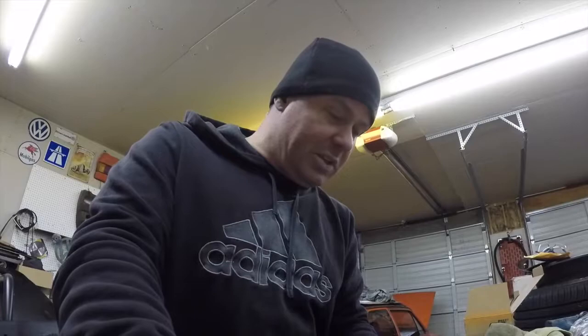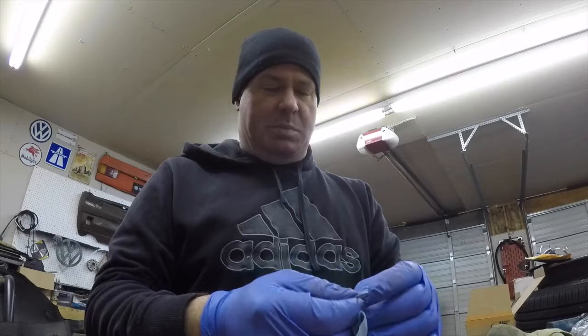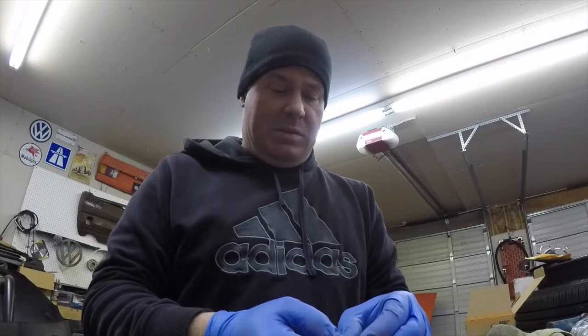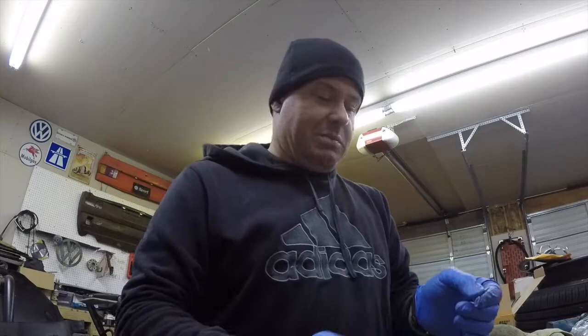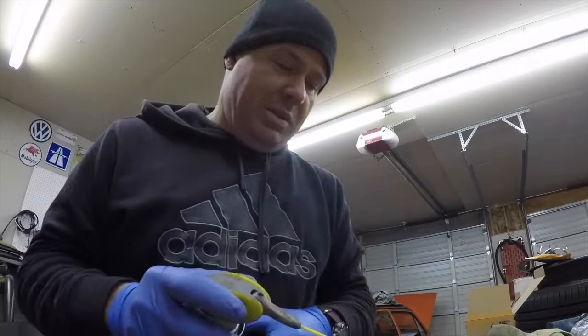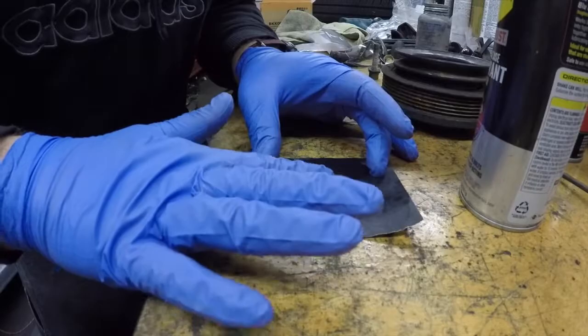The process to clean up these washers is fairly easy — it doesn't take a whole lot of skill or special technique. First I'm going to inspect the washers after I wipe them off, see if there are any ridges. Then I'm going to take a piece of 600-grit paper, wet it down with WD-40, and just sand these things out.